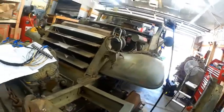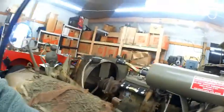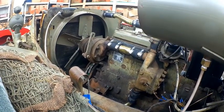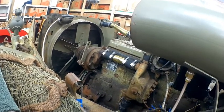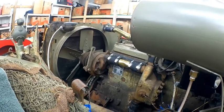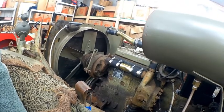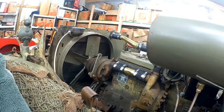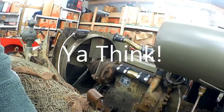I noticed with the 50 amp fuse, the point where you attach it on the lug had failed, and it was just micrometers, centimeters from touching the steel. It means I would have had a direct short from my battery, just like welding. So I'm really glad I tore into this, because that would have been a failure down the road with any vibration, a certain catastrophic failure. To have your half track catch on fire with wiring would be a real disaster.